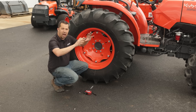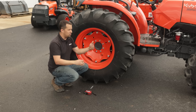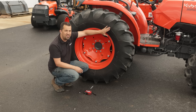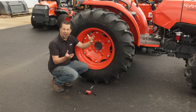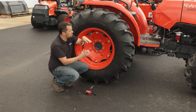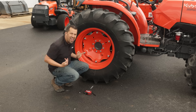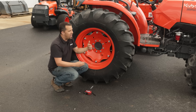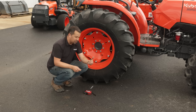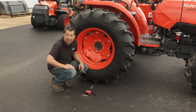As this is driving along, because the front tire is spinning faster than the back tire, it is literally dragging the back tires along — which is why we get a longer measurement. Now we're going to drop the tire pressure in the back tire. If you think of the tire as a balloon, allowing that tire to shrink back down even just a little bit should impact this measurement, requiring more dragging of the rear tire because it's now smaller to complete a full rotation. New chalk mark — going to drop the pressure down to 10 pounds and see what difference it makes.